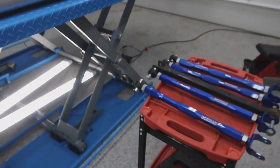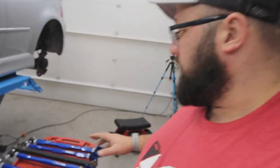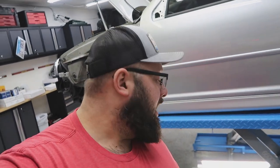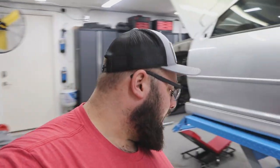So I picked up these Megan Racing adjustable control arms. Normally you don't need two adjustable control arms per wheel, you just need one, but since I needed four control arms I decided to order two per side. You would only really need two adjustable control arms per side if you were dropping or raising your car more than two or three inches and needed to adjust camber.